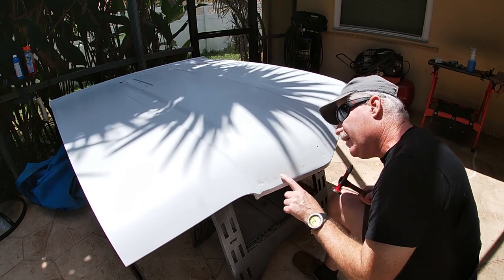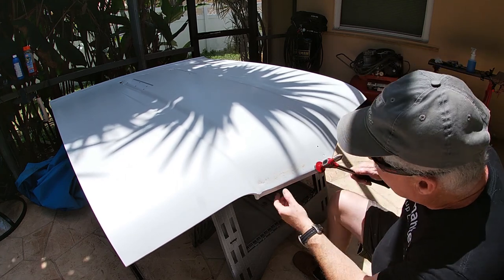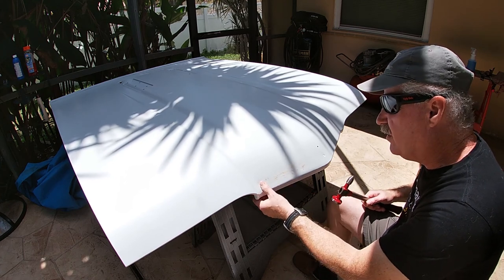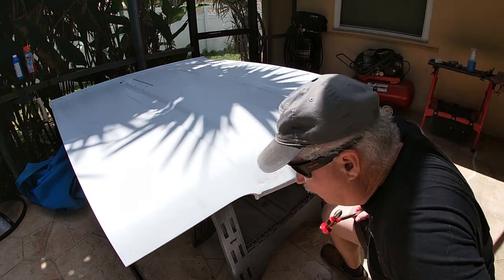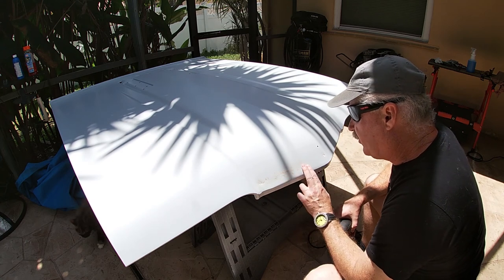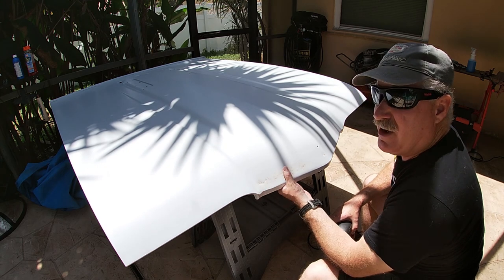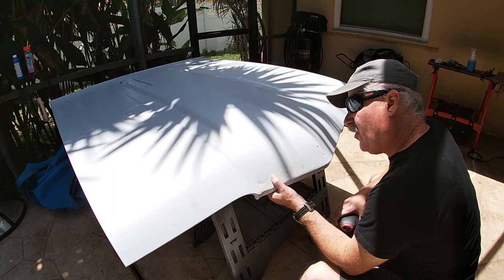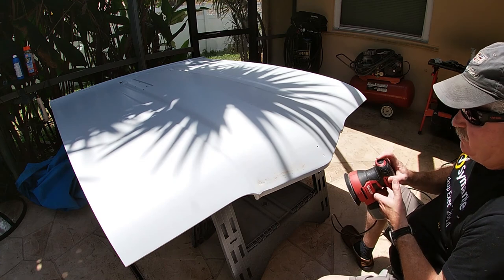Bad. Sure, I need to sand that down, but that turned out better than I thought it was going to turn out. So, need to sand it down smooth again, but let's take a look. Now, some of you may have been wondering why I didn't come after here with the dolly under here. There's an inner structure here that won't allow you to get a dolly behind it, so I just had to hit it from the top. Hopefully don't hit it down too far, because I won't be able to bring it back up again. All right, sand it smooth.